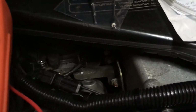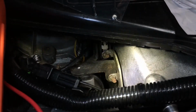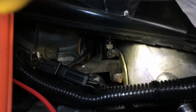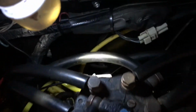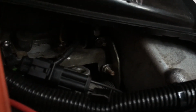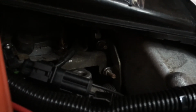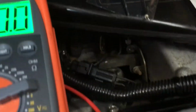There's a solenoid down the back there. So when you set up your throttle, with the ignition on, as soon as you open the throttle ever so slightly, it comes off the rest. You should then come off the micro switch pretty much about a millimetre later, and when that happens, with ignition on, that actuates the solenoid, which is just there. So you can put your hand on the solenoid and open up the throttle by putting your hand just down here. You can see it moving there, and as soon as you move a little bit, it clicks off the micro switch, and then that powers the solenoid or earths the solenoid. It does one or the other. It makes the solenoid open or closed in order to let the vacuum through to the distributor. But that's another story.